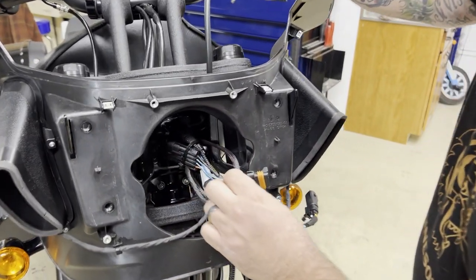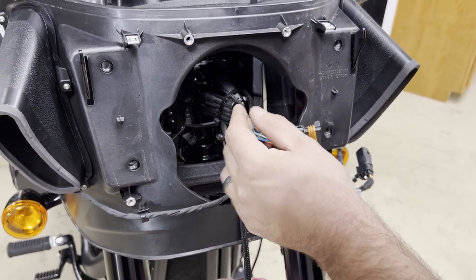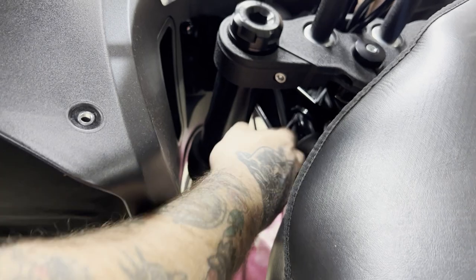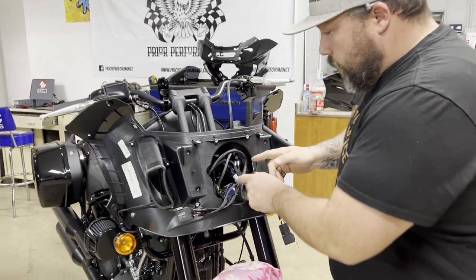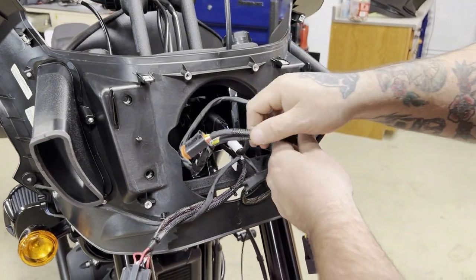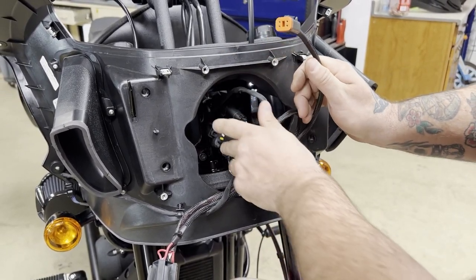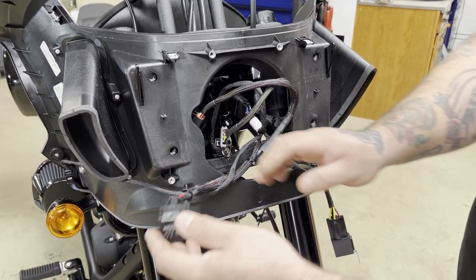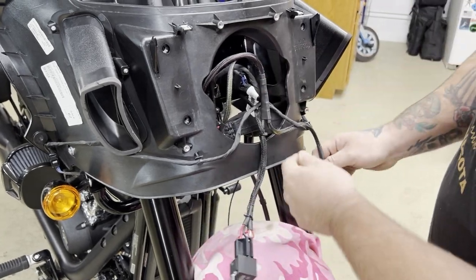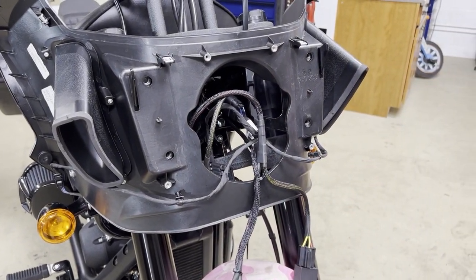Harley leaves you with a lot of extra wiring, especially on the audio setups, so we just slapped a zip tie in there to hold the Harley harness to itself. We've started feeding the battery whip of our harness through the interconnect and ran it out the side of the neck cavity. We also plugged in our headlight source plug — this is your stock leg and this is our new harness. The Deutsch plug for the LP6 light we're going to tuck through the side window. We want to leave these relays hanging, make sure these are on the outbound of the turn signals.